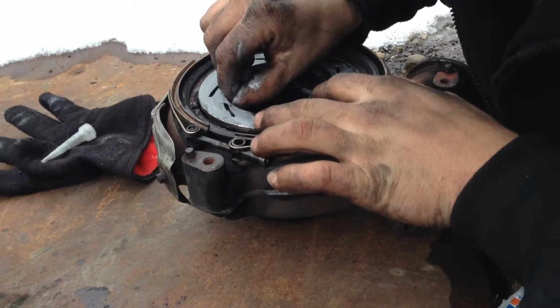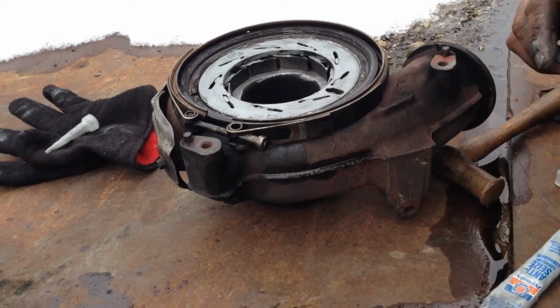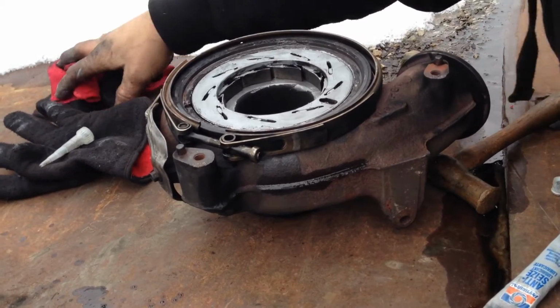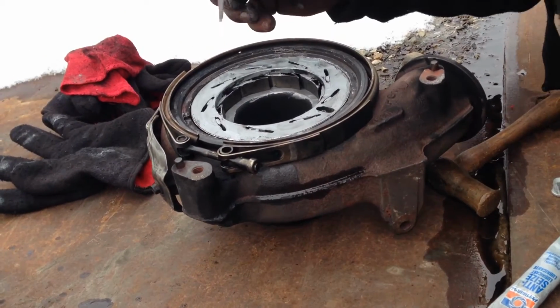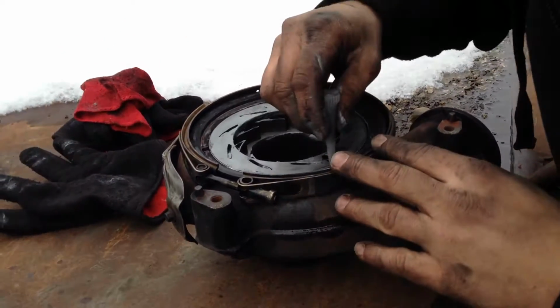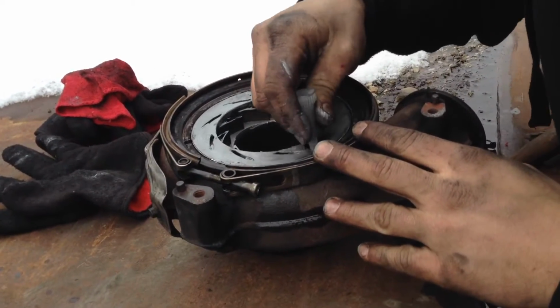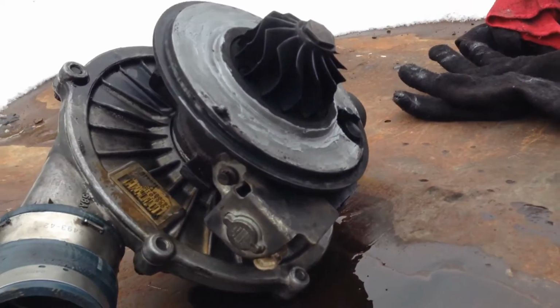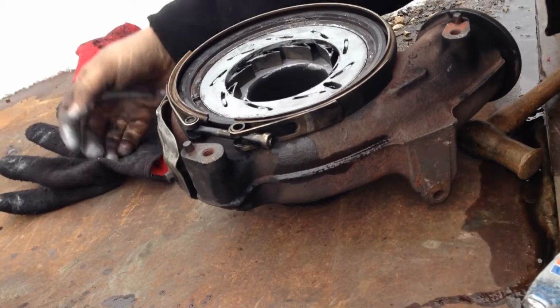You can actually just take these apart, clean them, and you should be good to go if you put a little bit of anti-seize on it. I recommend anti-seize. I don't recommend any other kind of oils for this, they might carbon up. So you want to grease basically everything? Yep, take it all apart.